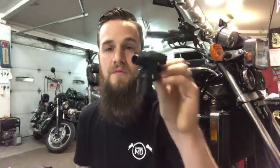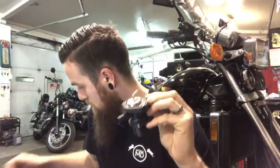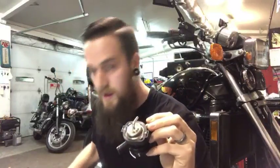But that would be putting a negative vacuum on the motor. And the thing is, inside of this pair valve, Neil, there's metal parts. There's a spring and a diaphragm. So if you were to suck that moisture from the crankcase, which is a watery, oily, nasty substance, A, it's gonna ruin the pair valve, because that's not what it's for. As soon as moisture gets inside of those and starts to rust them, that's when they start going bad.